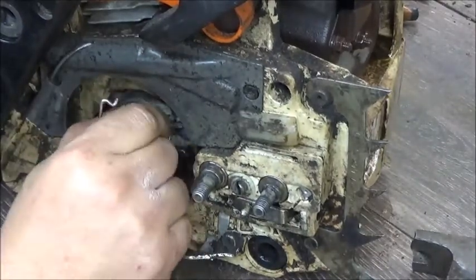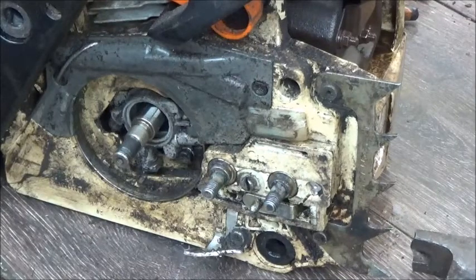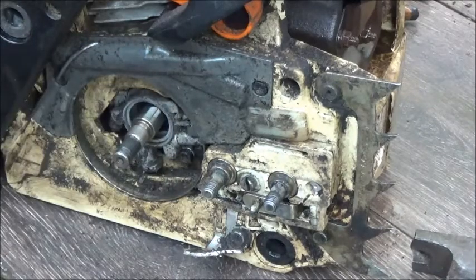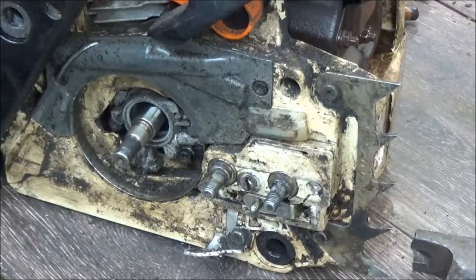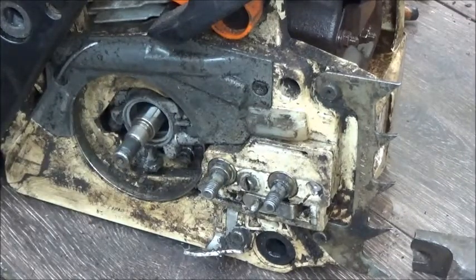You got your worm gear. I don't remember if these have a bushing or not - nope, we just got a big fat crankshaft. Some of your saws will have a bush in there, your older saws. Your 034s and 036s will have that bush in there. Your 360s and 026s - if it's a later one with the adjustable oiler - your older ones, the worm gear still goes in and just clamps down by the clutch. But you're not really able to run a long bar with those because that old oiler doesn't put out a lot of volume. These do have an adjustable oiler - these are like your top-of-the-line homeowner saw.